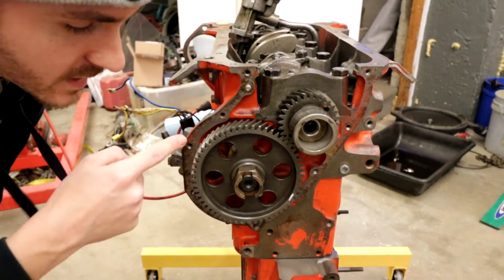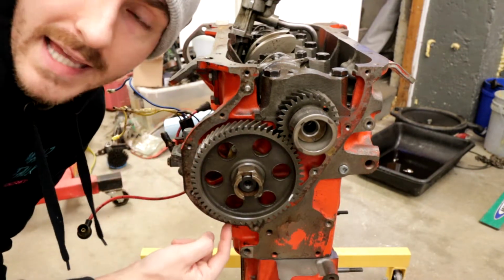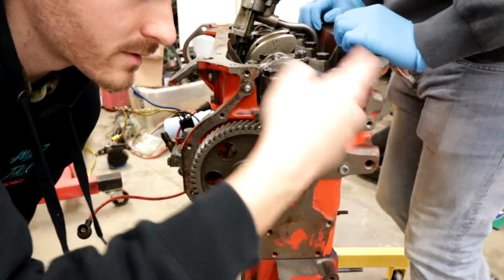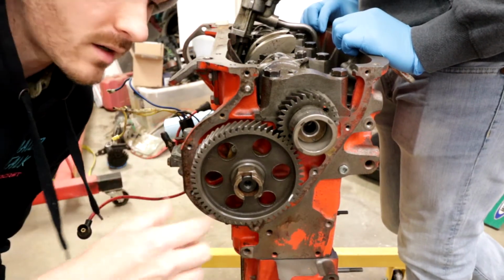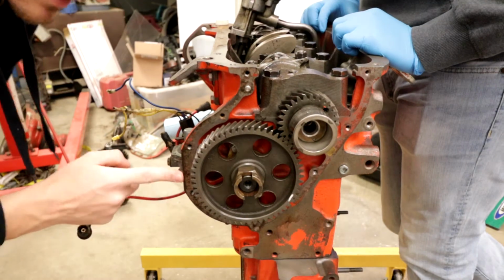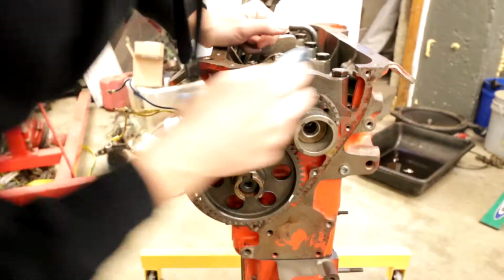Okay, we're gonna just clean the mounting surface. We're gonna do a bead of gasket maker, RTV, around the perimeter, put the gasket they gave us, and then do another bead on the cover. Bam, so it's like a nice sandwich. RTV, gasket, RTV. Prepping makes the dream work.